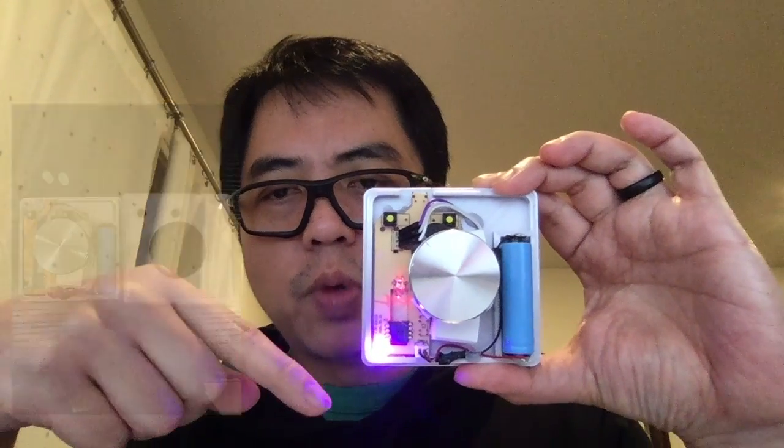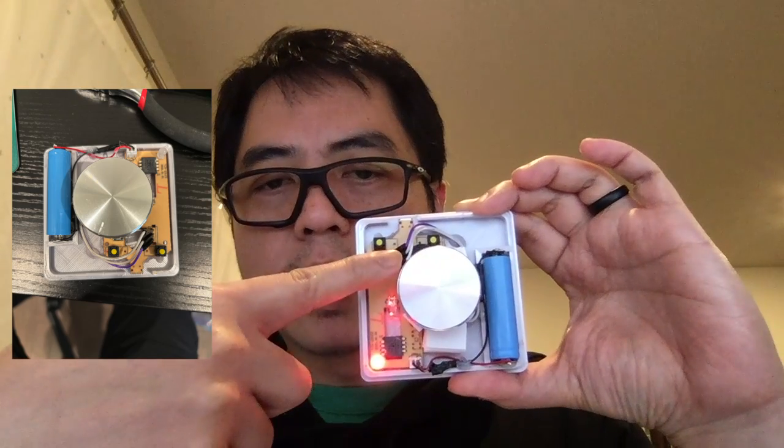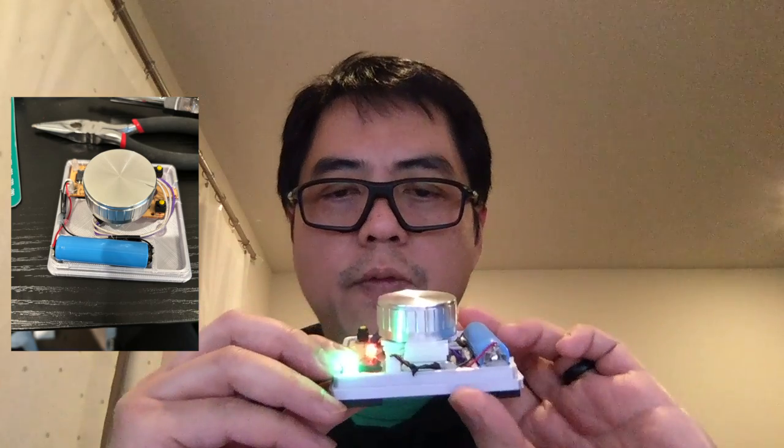Inside, I repositioned the components — the battery, the board, and the knob. You can see the wire I had to extend. The things you see are just double-sided tape you can buy from any store like Dollar Tree. I use that for two purposes: one is to keep the volume knob level so it doesn't wobble when pressed, and the second is that the middle mouse wheel button is right there so I can press it to play and pause the music. There's also a slot I kept open so I can charge the mouse.